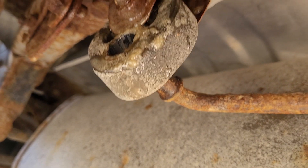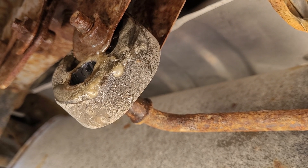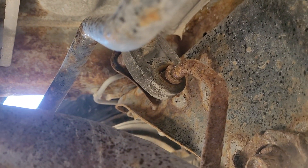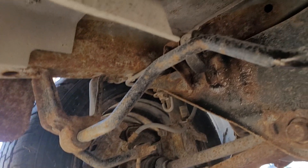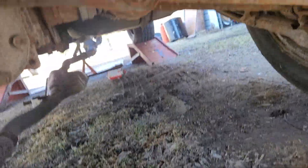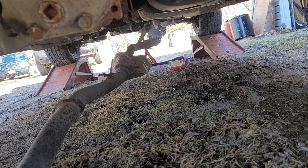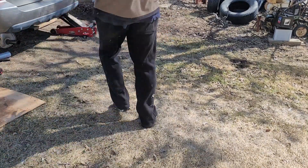I think this thing is still held on with one more hanger, probably in front of the muffler. I'll have to get under there and get that one too. There the silly thing is — back here by the muffler. It looked like an easy one but it wasn't, and it was already broken on one side, so I just decided to cut the other side. She's down. Muffler is down. Just gotta let her off the stand in the front and then pull her out the back.